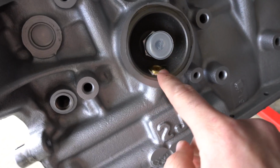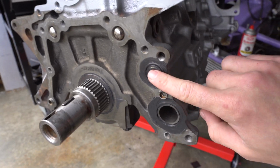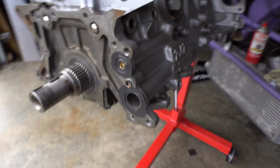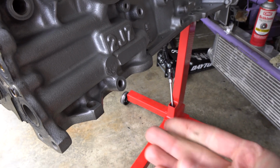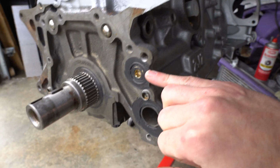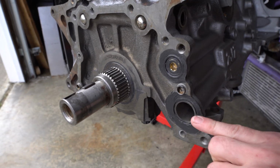But I am really quick going to say the sizes of all of these. So this is a 3/8 MPT that you have to get a tap for, and then you have to drill this one in actually pretty far so that you can get that flush in here. That RTV is not all the way dry yet. I put that RTV on here to help the O-rings stay in while I'm doing all of this, just because they like to pop out on these.